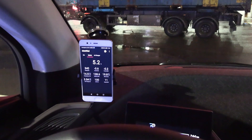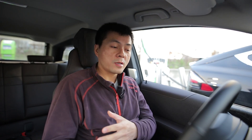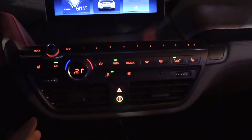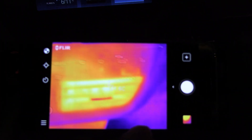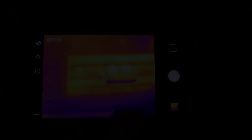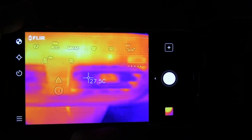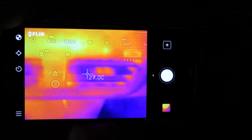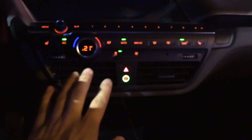Before I do that — did you also know there's a bug where if you arrive with too low a state of charge and you want to charge the car: when you are plugged in and charging, and you fire up the car, you won't get heat in here. You might not believe me, but I did the test. I went out and tried with a thermal camera. Initially you get some heat once you plug it in, but that's just the leftover heat from earlier. After just a couple of minutes, you see the air vents start turning bluish — because it's not running any heater, it's just recirculating air. So basically you don't have any heater while you are plugged in charging, unlike many other EVs.